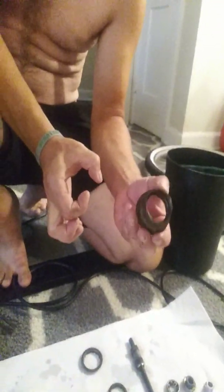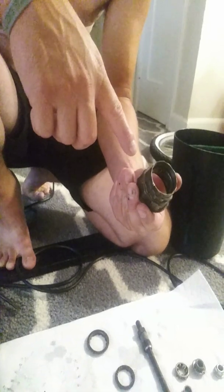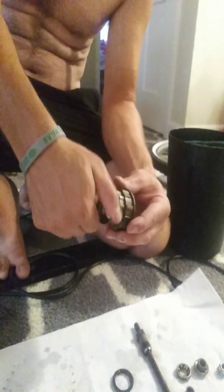This is called a freewheel body. If you had a cassette, you would have a one-inch spline sticking out of your hub for the cassette to slide off. This kind of works the same way — this ring actually threads into here and it's sort of like a cassette assembly. You could take it partially apart, just leave the raceway ring in on the wheel and slide off the sprockets to change them. It works the same way, but I like to take the whole thing apart and service the whole thing because it's going to work better that way.